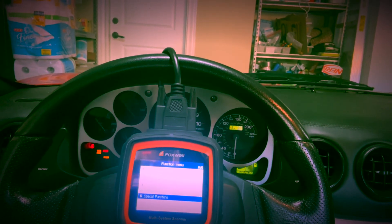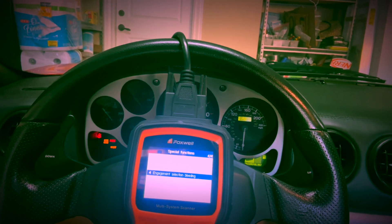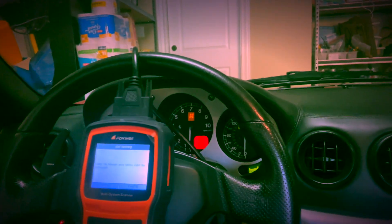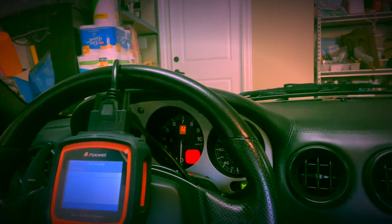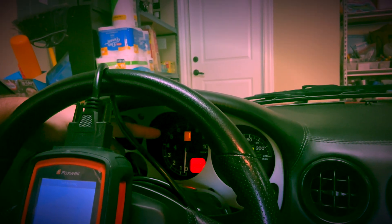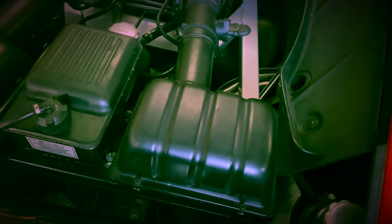Under special functions, there's clutch configuration, point of initial slippage, bleeding of the actuator, and engagement selection bleeding. Under active tests, there's a self-learning function at the top. Hit F3 to start, then F1 to begin activation. The car cycles through all the gears — you can see it on the dash indicator and hear the pump and actuator cycling through the learning process. This recalibrates everything so the car shifts as cleanly and quickly as possible. Activation complete — everything's done, back in neutral.